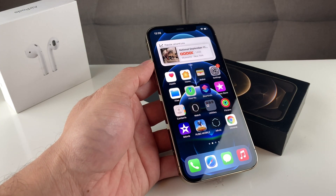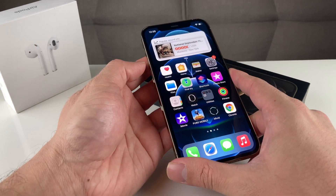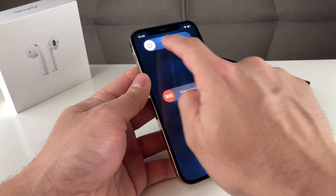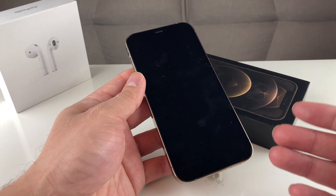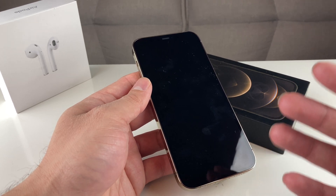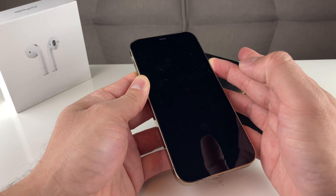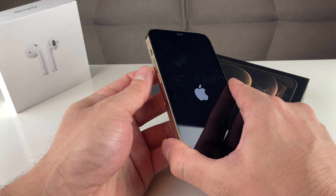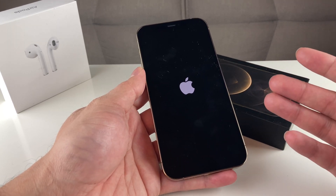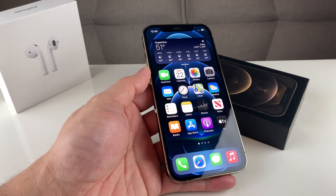If none of that has worked, restart the phone. On newer iPhones like the iPhone X and above, hold the volume up button and the side button on the right side together at the same time. You'll see the power-off slider — slide it to power off and let it slowly shut down. Power cycling is always a good idea when you have issues, as it clears everything out and gives the phone a fresh start. To power back on, hold just the side button until you see the Apple logo, then let go and wait for it to fully turn on. After it does, check your volume and silent button again.